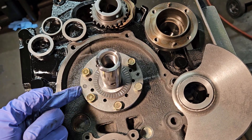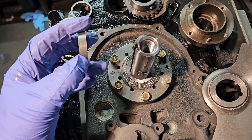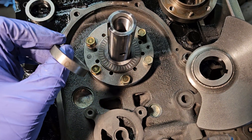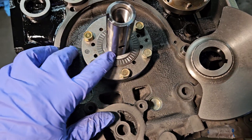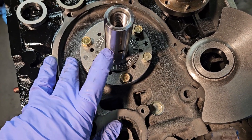There's a little bit of work underneath, but essentially your spacer — which if it's an FD3S or RX-8 would look like this and has lettering for identification. That's a C, so right in the middle: A, B, C, D, E, F would go right here. I've already dropped one in. This particular one is a C.